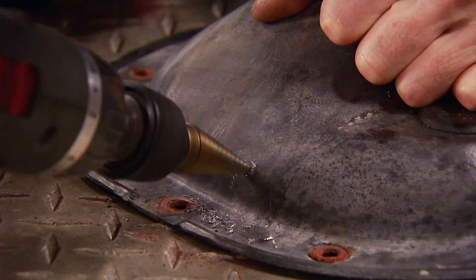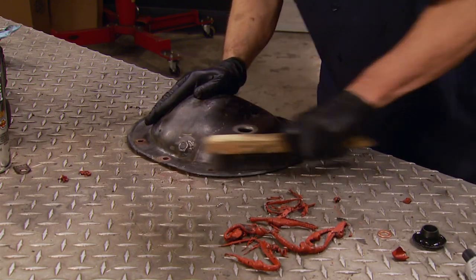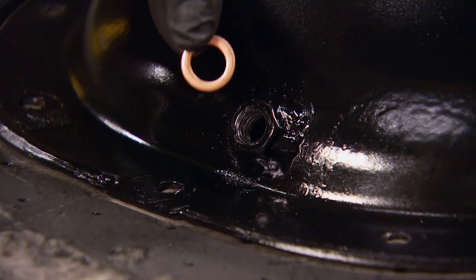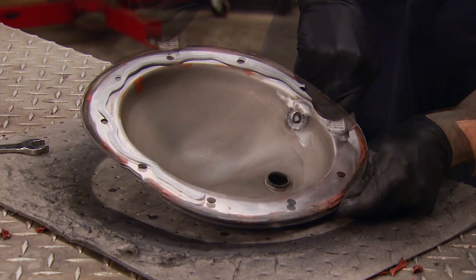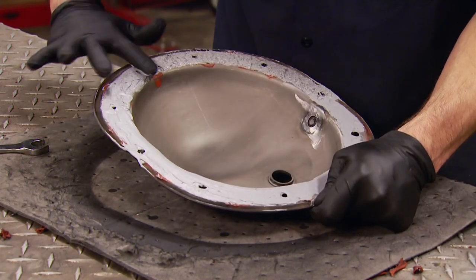After drilling a small pilot hole, I switched up to a step bit — it worked really well at drilling metal less than an eighth of an inch thick. If you don't have one, you might want to add one to your arsenal. Then we scuffed off some of the diff cover paint so we could weld the nut into position. Then we broke out the wire brush, cleaned things up a little bit, and followed that with a little degreaser and a shop towel — because we've got the diff cover off, might as well paint it. This little Duplicolor black makes this thing look like new. Then we reinstalled the drain plug with a copper washer and snugged things down. A little Loctite RTV to seal this thing back up — not gluing it back together, just sealing it. I like to spread the bead of RTV out evenly on the flange, then texturize it as an indicator of whether I've got enough RTV or too much.